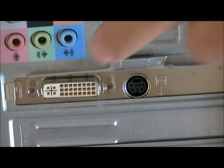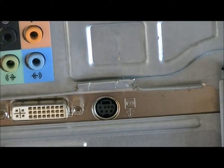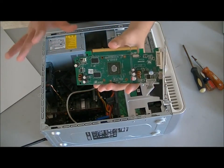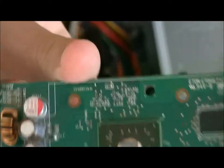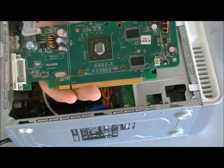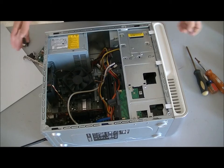What makes it called a video card is this thing where you plug in the S-video. I had to replace mine because my monitor was going on and off and I was getting blue screens. To tell if your video card is messed up, remove the old one and remove the fan that usually covers it. Check if the little tiny chip in the middle is burnt out or not. As you can see, this one is black and messed up, so I had to get a new one.